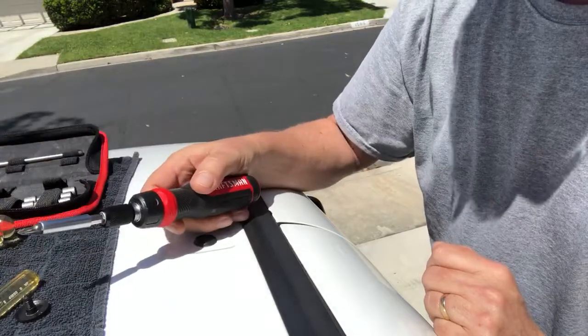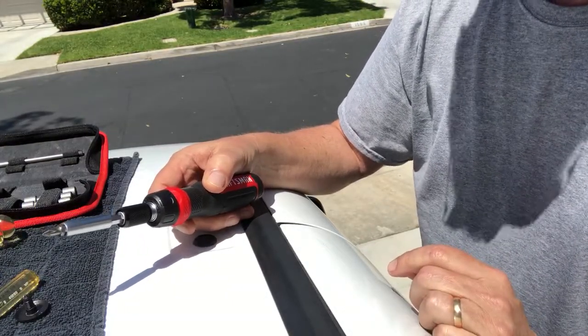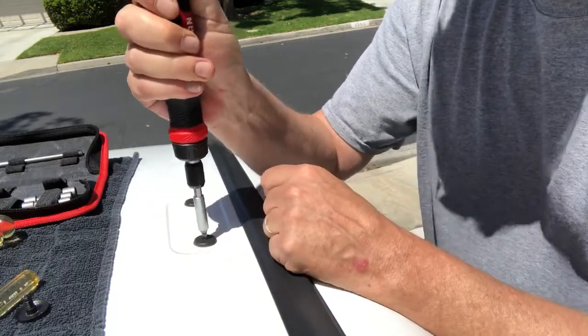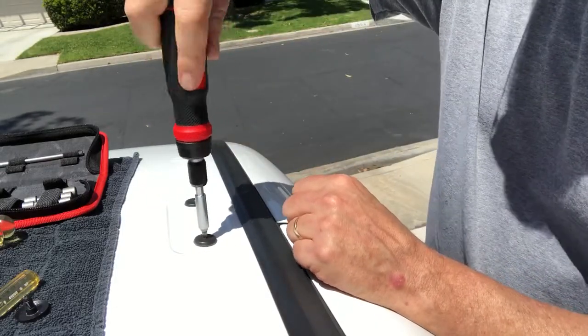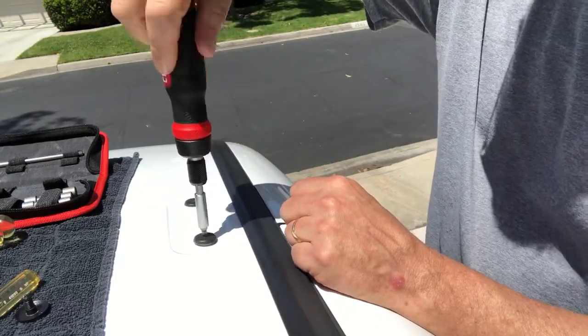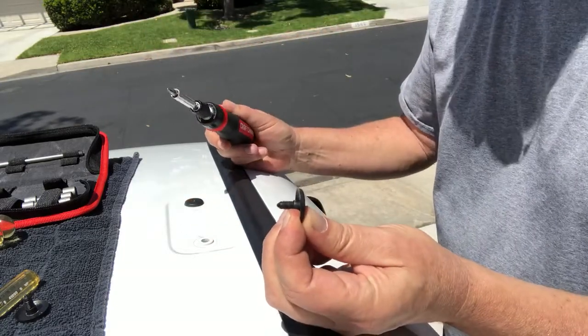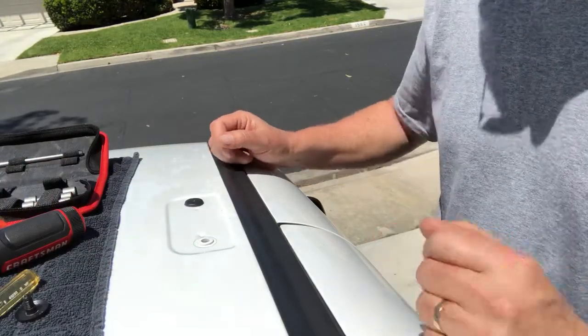So then I found a kit that has a little bit bigger screwdriver. This is actually a number one Phillips head. You sit that in there, get some good grip on top of it, and pop — it pops right out. Make sure you keep some pressure on it, otherwise you will strip it even after you get it going. But that is it — the removal of a mounting plug on the roof of a Dodge Ram ProMaster City. Have a great day.